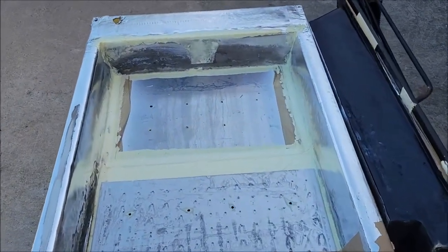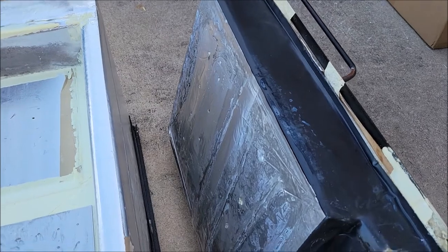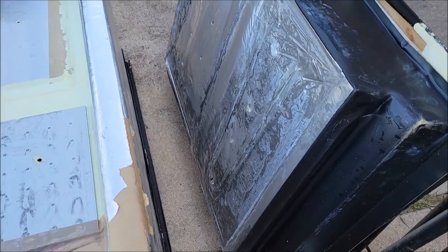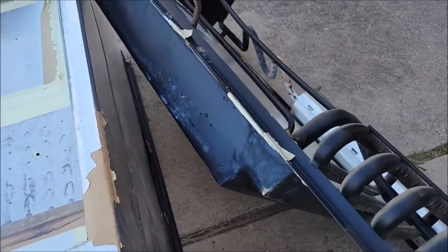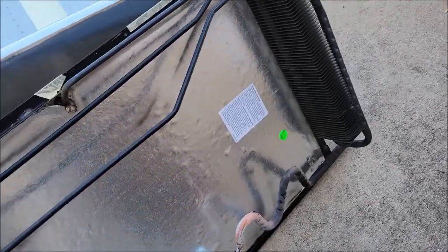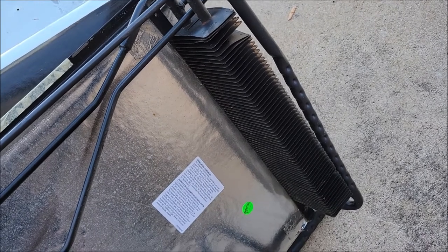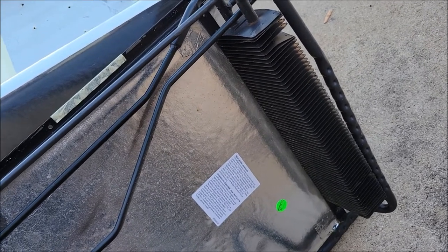This little area here is the cooling system. Here's the front of what that looks like. There's a plastic housing that goes over this, and then there's the metal with what looks like aluminum tape that helps transfer the cooling. This whole compartment right here is where the cool transfer goes, and the heat transfers out of this. If you look at the top of your RV, you'll notice there's a vent that lets this heat go out the roof.